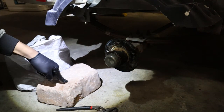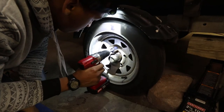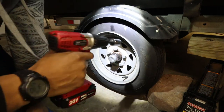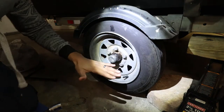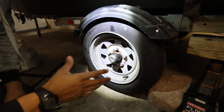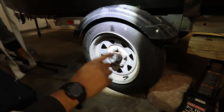Lastly, put your tire back on and rotate your wheel chock to the front of the tire, because tightening the lug nuts turns to the right, which can push the trailer that way. Get the lug nuts snug first while the wheel is still in the air, then lower it down and tighten them up. Don't overtighten, but get them good and snug — follow torque specs if you have them, otherwise get them tight with a bit more after snugging.